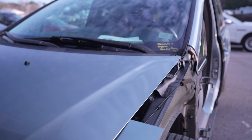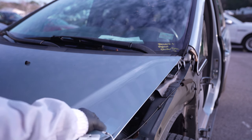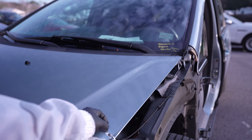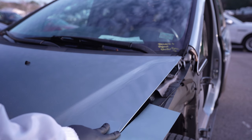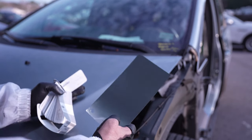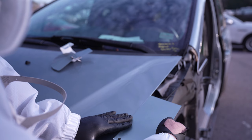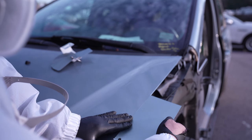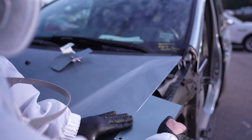This is going to be the most crucial area to what we're going for. You guys can see there that we're very close to what we need to be with this color, especially against what we started out with — that very dark, more violet color. You've got to get an in-between color because you have areas that you're meeting up to as well as areas that you're going to panel paint. I'll always go to my panel-painted areas first, and once my color is close enough for that, it's obviously going to blend. I'm going to do a little tweak — I'm going to add a couple drops of black. I think it needs a little bit more black in it, and then I think we should be good to go.